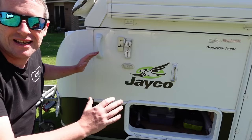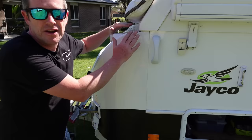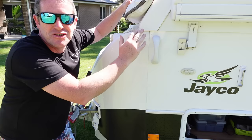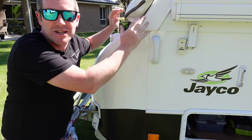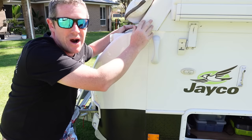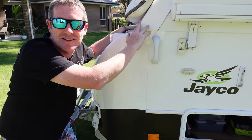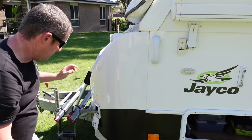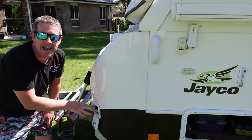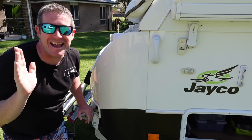Now it's a simple case of going around, pulling the roof down, doing up the roof latches, and then I'll give you a little tip and trick with the winder. On the front in particular, you want to make sure the seal on the front is compressed to a reasonable degree — don't adjust your latches so that it's popped up because you've got too much bedding inside. You want it down so this seal is resting on the top edge, but not down so hard that you end up cracking the end caps. This seal is a weather seal to reduce the chance of any water splashing up inside when you're in transit. My other tip is once you've got your roof fully secured, wind the handle around a quarter of a turn or until you just feel it grabbing — that will make sure no cables jump off pulleys while you're in transit.